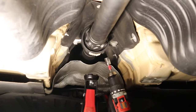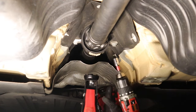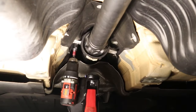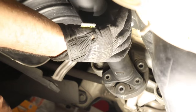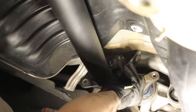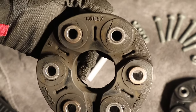Your center shaft bearing bracket is held on by two 13mm screws — remove them, and just have something to support the shaft when it falls down so it doesn't hit the ground. Now simply grab onto the drive shaft and pull towards the front of the car and it should come right off the guibo. Slide it off — there you go. This is exactly why you should probably replace yours as well.